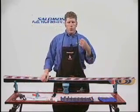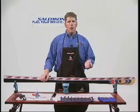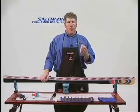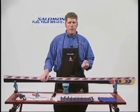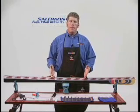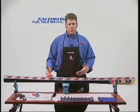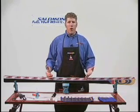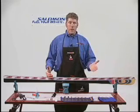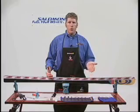The reason you do stone work on the ski edge is to harden and polish the edge so that it's very smooth and cuts well. The common misconception is to feel the ski and say, wow, that's really sharp — but that's actually not the truth. Commonly when people do this, there's a burr formed on the edge, and it's not smooth; it's actually very harsh. When you form a very smooth edge, it cuts into snow — ice more specifically — much easier and smoother, giving you the ability to control the ski through turns.